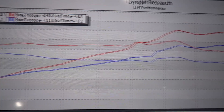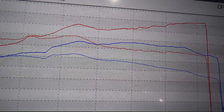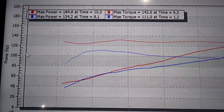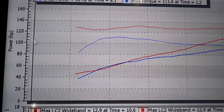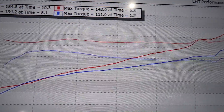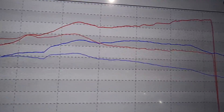There is how it runs right there. The blue is with the supercharger dragging; the red is stock. As you can see, it takes power right from the get-go. We're hitting it in the same spot, so you can see how much the supercharger is dragging on the engine.